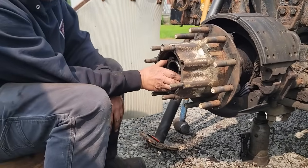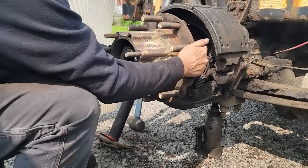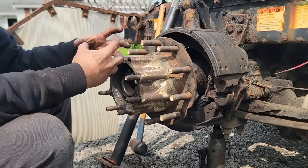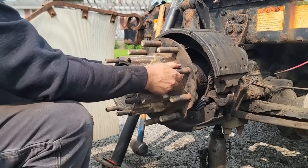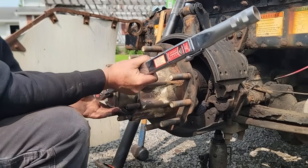Yeah, gotta make sure it locks into place then. It was in between two. Check your input. It should have a little bit because as the bearings heat up, the rollers and the races, they're gonna expand. So if you make it too tight, then premature bearing wear, race wear. I don't like how loose it is. I like that a little tighter.